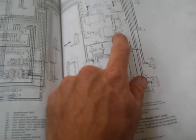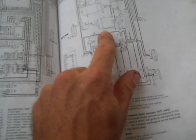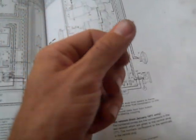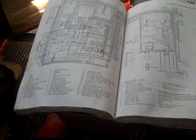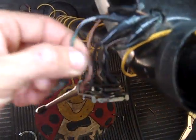It looks crazy but it's not that hard once you start paying attention. Your alternator has three wires coming out of it — once you know where they go, one's a ground that just dead-ends. A lot of times you'll just have grounds, but all your grounds may go together — somebody may have tied them all and screwed them down to one big screw. So where it looks like a dead end it may follow off, and if those grounds aren't screwed in right or any one is touching metal, you're going to have problems. It may look complex and seem unbearable, but it's usually pretty simple. It's just a matter of taking the time to do it rather than going through three or more mechanics who never fix it anyway.